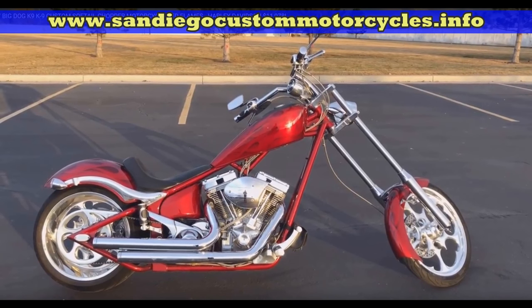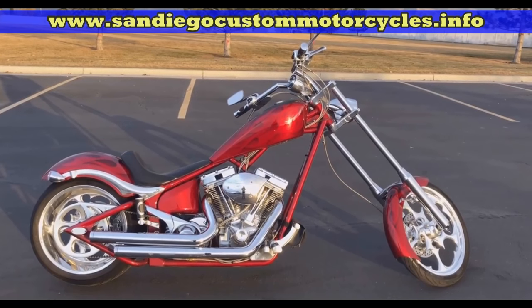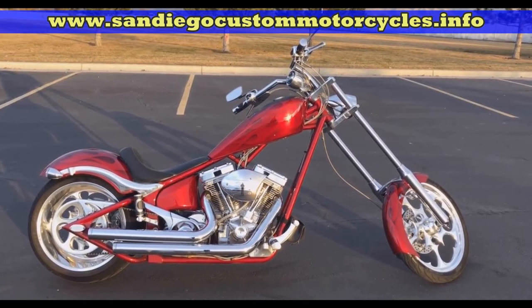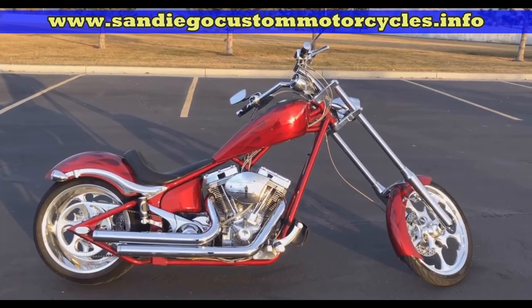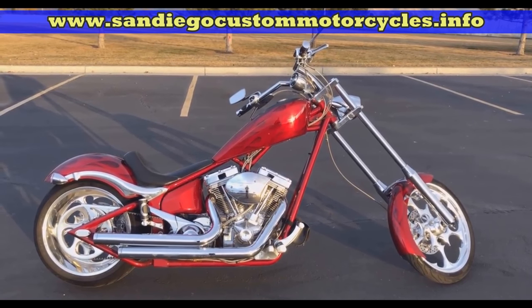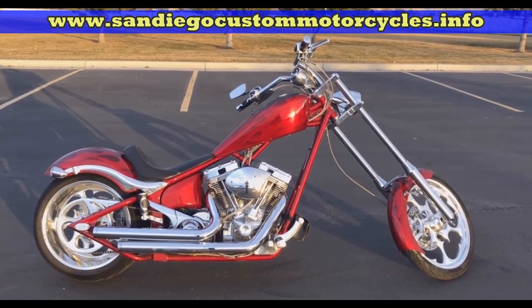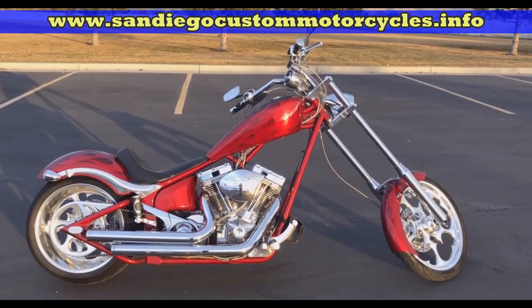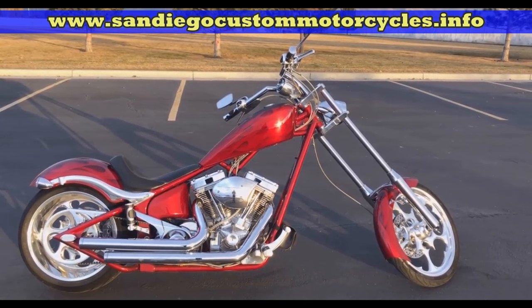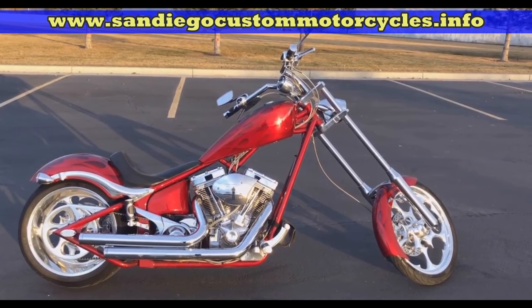I do it on the manufacturer's recommendation or once a season, whichever occurs first. It's economical, cost-saving, and time-saving to do this at the same time you change your motor oil. On my bikes I always use synthetic for the motor, but like I said, use regular 20-50 for the primary chain.